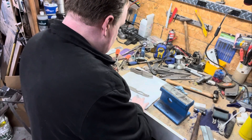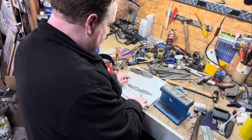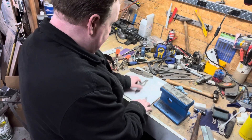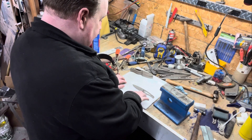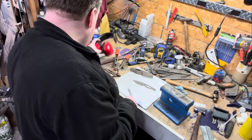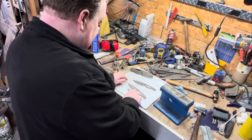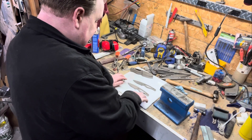I'm going to sit this here and run this in — wrong way, it should be this way. When you're checking this, you want the warp down, the U downward facing. This one's borderline. It's twisted over here so there's no resistance. When you get towards the back, it's close right there — so this is out of spec, not a lot. I'm going to grab another one. I've straightened those in about 10 or 12 minutes. This is a good example, this one's also borderline.